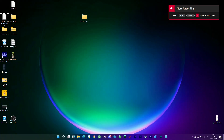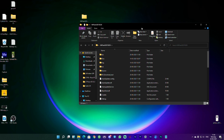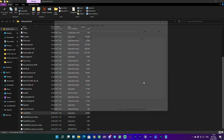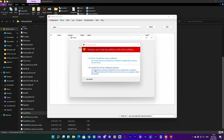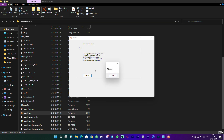Now back on the desktop, go to the flash tool folder where you extracted it, scroll down, and look for 'Xiaomi Flash' — double click on it. Then go to 'Driver' and click Install. This is why we disabled driver signature enforcement. It will give you prompts, so click 'Install this driver software anyway' — this will come up about three to five times.